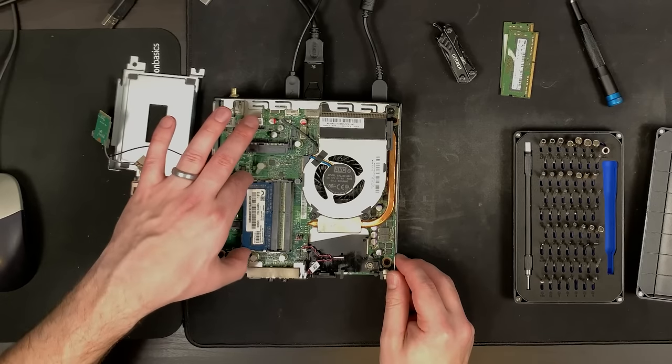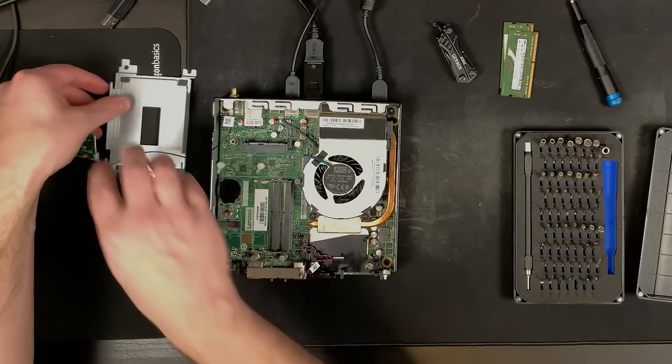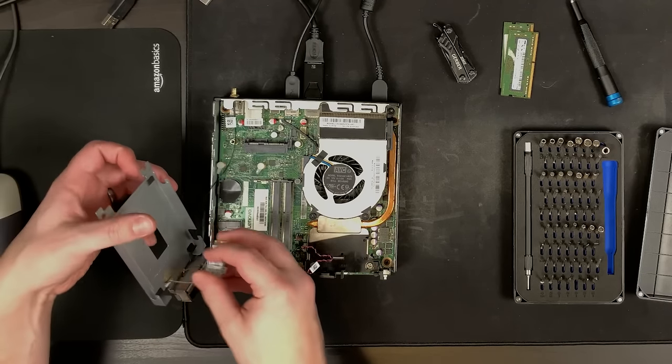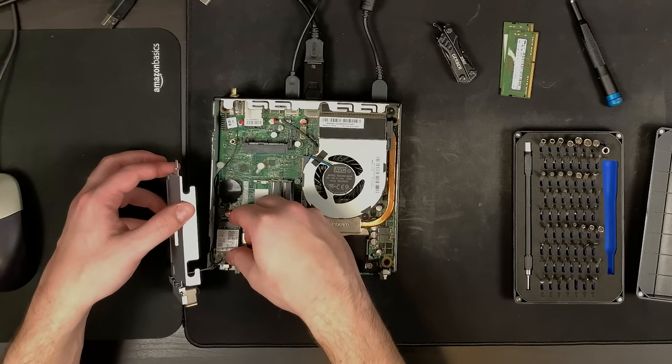Could try swapping the CPU out - it could be a bad motherboard, or could be a corrupted BIOS chip. If it's a board-level repair issue on the motherboard I'm probably stuck there, because I did get a hot air station but that does not mean I know how to repair these things. I'm actually going to pop system three on here and then see if using good RAM we can get at least maybe two easy fixes.